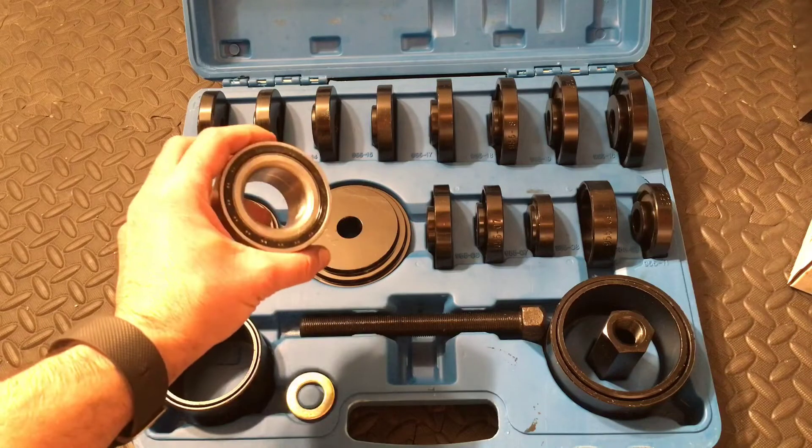Now that we have this set up, I'm going to put all this together to show you exactly how it needs to go so we can start pressing it in. Here's the bearing, then we have this adapter that's going to be pressing down on it. We went ahead and used one of the washers that comes with the set, and here we have our tightening nut on this end. On this side of the knuckle, we have this adapter with the plate on this side — this is pretty much going to be allowing us to push the bearing in. We're going to push it about three quarters in with the impact wrench, then come back using the breaker bar to finish tightening it up.